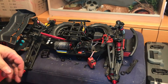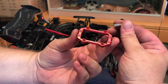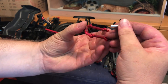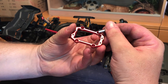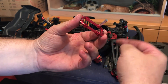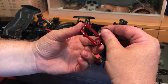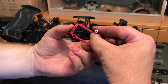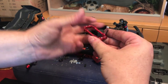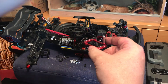You can see on one side of the plate these holes have got a kind of recess, and on the other side there's a countersink. The post will only fit into that recess one way around and it has a little boss on the other end which is too big to fit in there, so you literally cannot assemble it incorrectly - it's impossible. So we're going to screw the posts in first, then mount the servo, and then screw the whole assembly back into the car.